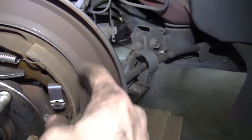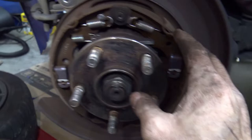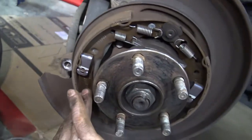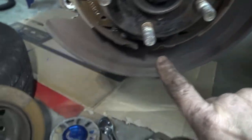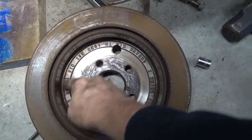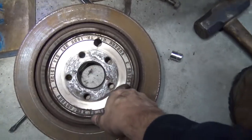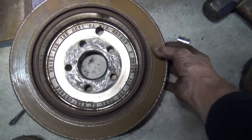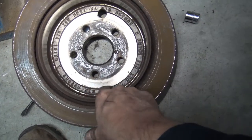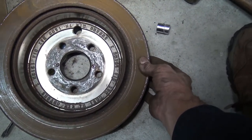As you can see, everything looks pretty good. The brake shoes are not worn — I wouldn't expect them to be because they're just used for the emergency brakes. The springs and everything else — nothing's broken, it's looking pretty good. And on the inside of the rotor, it does give a minimum thickness for the rotor measured on the wear surfaces. Subaru minimum thickness is 16 millimeters.